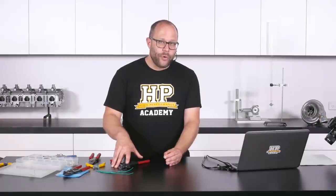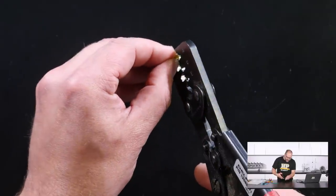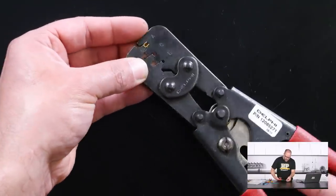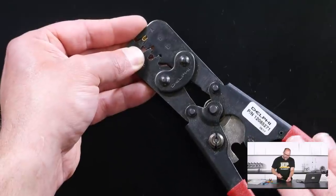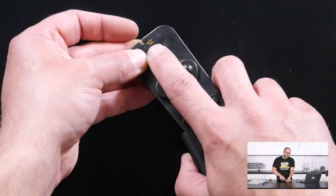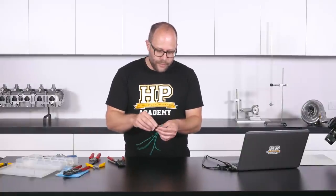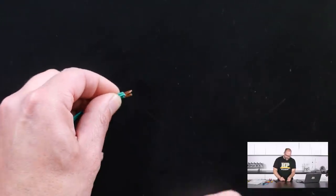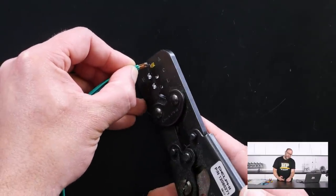These are the most common size of splice I use, so that is the most commonly used jaw on this tool. This tool really does see an awful lot of use when undertaking a complete harness build. What I'm going to do is get that installed in the end of the tool. Because this is a ratcheting tool, I can put a good amount of pressure on those handles and it's going to keep itself in position — keeping my splice nicely installed in the end of the tool here. That's going to be really important because splicing, like a lot of jobs when building a wiring harness, would be really handy to have a third hand for.